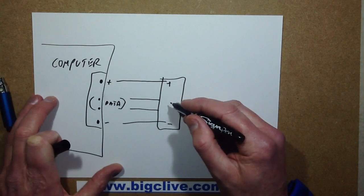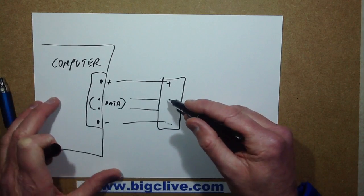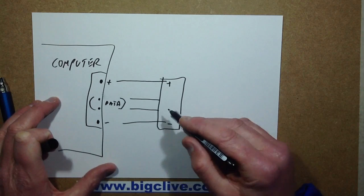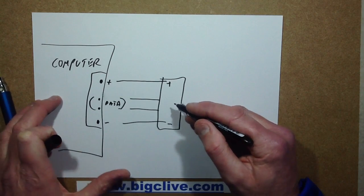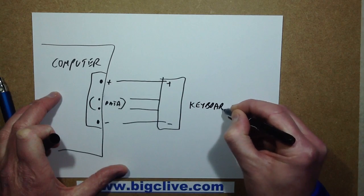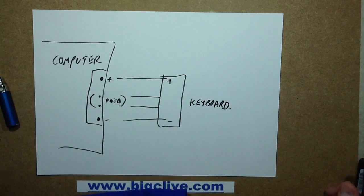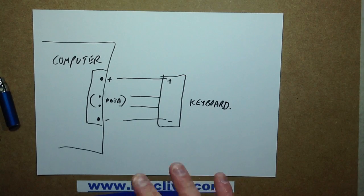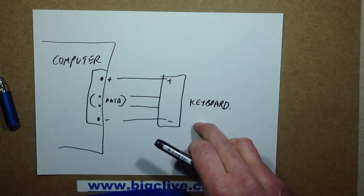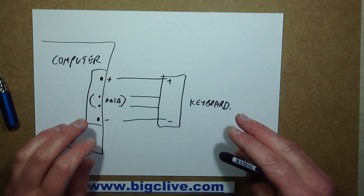Some have come up with the theory that a small memory chip could be put in, like you'd find in USB memory sticks, and it could load malware through Autorun. But there's another more interesting theory: if this is a microcontroller, it could actually emulate a keyboard. When you turn your computer on, it could access the BIOS by, at power-up, as soon as it received power on the USB bus, it could start pretending it was holding down the F2 key, and then blindly use the up, down, and enter keys to find its way through the BIOS.